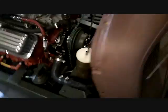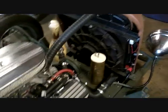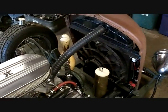Why would I put water first? Well, say I didn't tighten that bolt and it's peeing out on the floor, or I forgot silicone somewhere. The water isn't going to kill anybody. Antifreeze, of course, would be before the winter, but we'll get the right mix. I'd like to see how many gallons it is, too, so that's a good idea. I'm off to get number 3 from the hose.